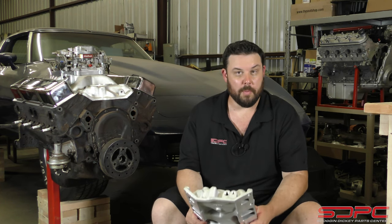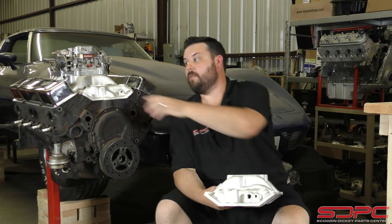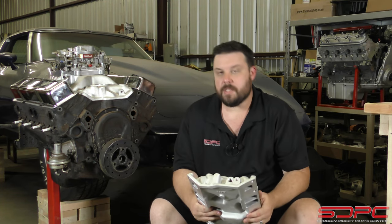There are a couple of things we've heard about people bypassing it. While we have no personal experience with what I'm about to tell you, I have heard from quite a few people searching online finding customer responses that seem to have good success: people have drilled holes in the thermostat, which does the same thing — it just does it all the way through the engine. It seems to work for a lot of people. I would be cautious in trying it yourself. Make sure to keep a close eye on that temperature gauge if you try to do that.